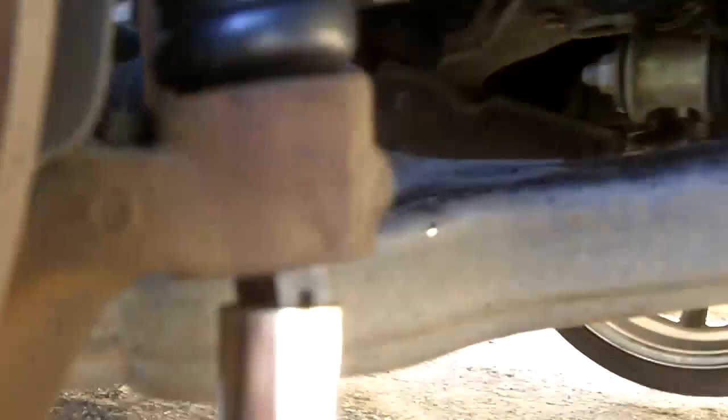And as you tighten it, it starts to wedge itself inside here, inside the steering knuckle, because the bolt on the end of the ball joint has like a taper type of deal there, which allows it to squeeze inside the steering knuckle hole here to tighten it, to keep it locked in place. But you still got to also lock it in with the cotter pin here. You just gotta find the hole like that and bend them down. But I'm gonna torque it a little more just to be on the safe side.